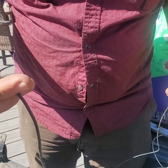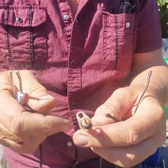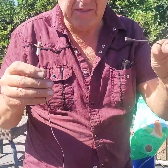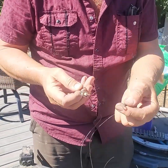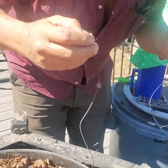I'm trying to replace the igniter, but this is the original igniter and the new one that came with the kit is too big — it doesn't fit. What I will do is throw away the new igniter but reuse the second wire from the original igniter. On the end it has a nice hook, and I will put this under the screw.